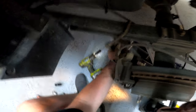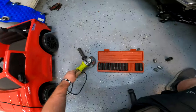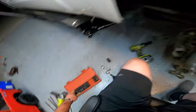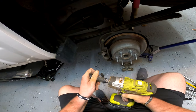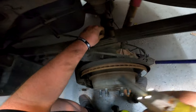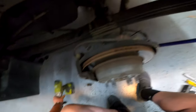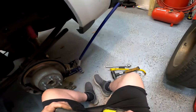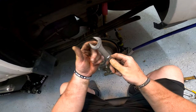Old U-bolts out. Keep the perch plate — you reuse it. Next thing you're going to need is a 15 millimeter. In my specific application — and if this helps you, please subscribe and like the video — you have to take this bracket off. You also have to take off the rear shock. So grab a 21 millimeter socket and a 21 millimeter wrench — grab the nut on the front and hit it from the back. Then use the crow's foot end to help pull it out.